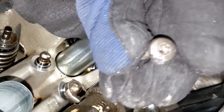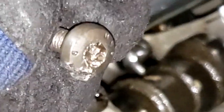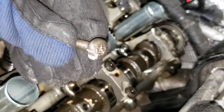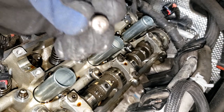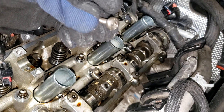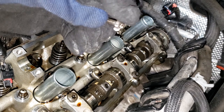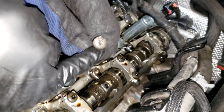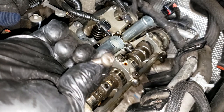All right, guys. I'm going to say this again. Always use a real good T30. Okay? I don't care if you got to get a Snap-on that costs $50. Quality is what matters when it comes to this. So don't skip on quality when it comes to a socket bit. The first one I used was cheap aluminum and it bent, and it caused some of the fittings in here to be compromised. So if you don't do nothing else, make sure you get a good T30.